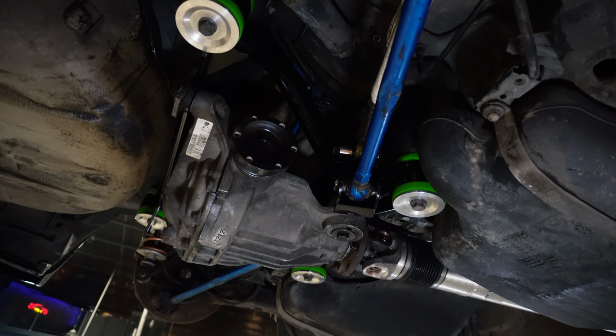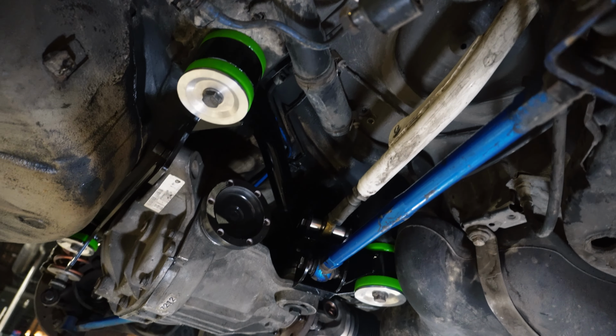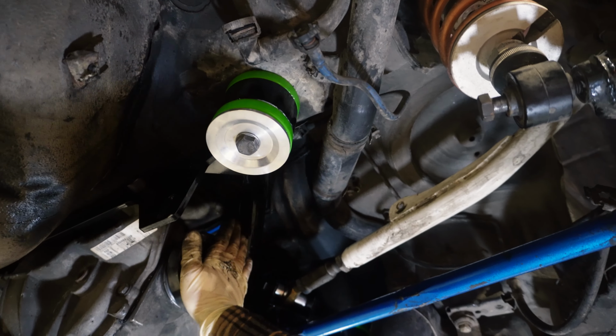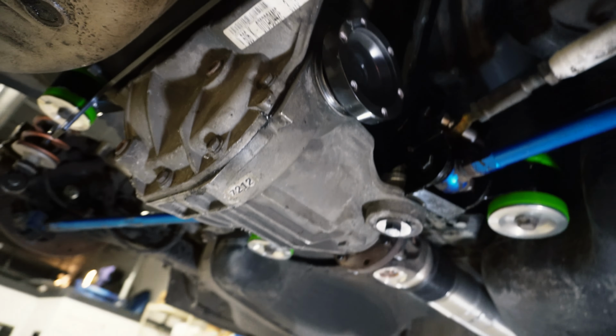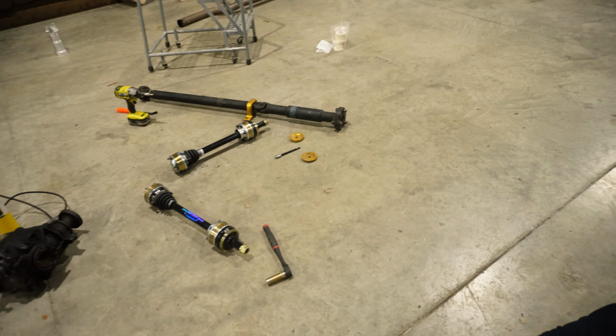All right, so we got the axles apart for this install because the arms were in the car. We decided to take the inner stubs off and install them first. Dylan, give that thing a nice push into the diff for the satisfying click you're gonna look for. Oh man, it's good. Maybe we need a piece of wood. Smack it in here a little bit. There you go. All set. Dude, she's smacked. All right, for the next, we'll slide the axles in.